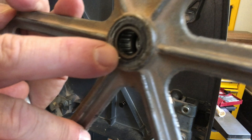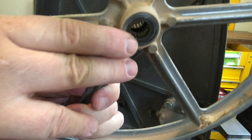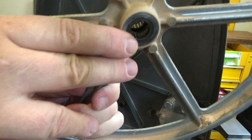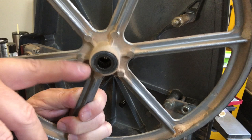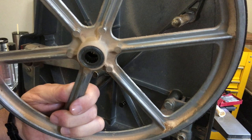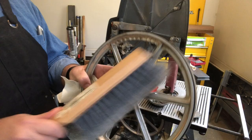Let's look inside of this wheel. As I mentioned, there are needle bearings here, and if you look through that hole you can see there is another needle bearing on the other side — so a pair of needle bearings. Because this is a used bandsaw, I have no idea what's in here, so I'm going to get rid of that grease. I'll do this with the bearings mounted right here on the wheel — just spray it, saturate it with the degreaser, and then use a paper towel rolled around inside to roll those needle bearings around. This isn't an exact science.